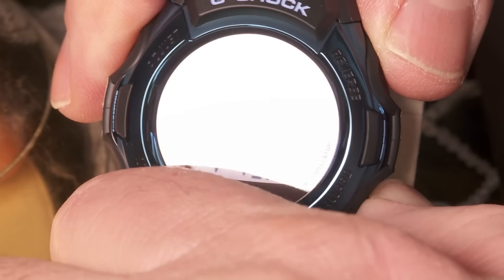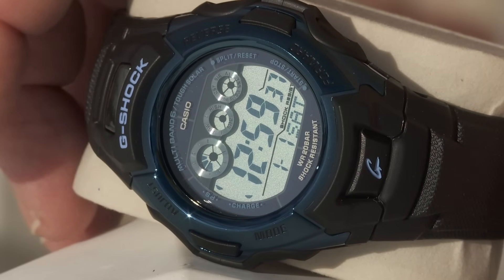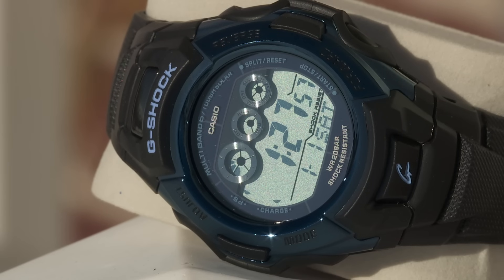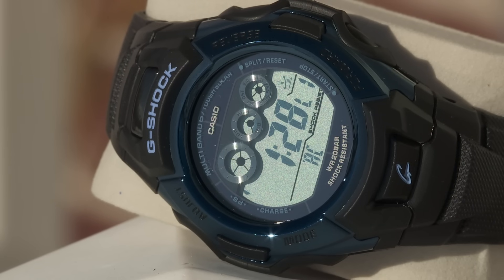Now I've proven the watch does work, and I just need to give it a really good boost. I took it outside — I had something to do outside anyway — so I put it in direct sunlight and let it sit. This was about an hour after the watch had started to work using the artificial light. After about 28 minutes in the sun, the watch jumped from the lower-than-low charge state up to the middle charge state, and then it tried to set itself using atomic timekeeping — it turned on its radio receiver. The receiver was showing level one most of the time, occasionally jumping to level three, but it wasn't going to work because the watch was still set to Tokyo time and trying to pick up Japanese atomic radio frequencies.